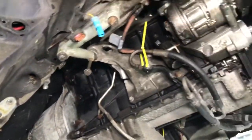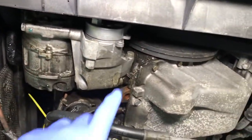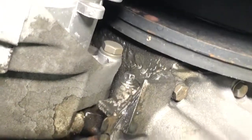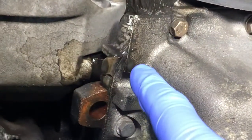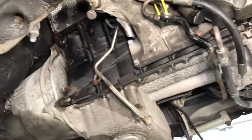We don't want to see a corroded manifold under there, and that also gives us much better access to some of the engine oil leaks that we're seeing. We've got an oil leak coming down from the timing case, which is quite dirty, which has been going on for a while, and some fresh oil droplets there and there. So there's some things that are going to have to be looked into in that area and addressed whilst the car is apart.